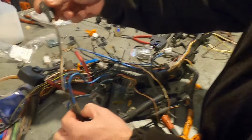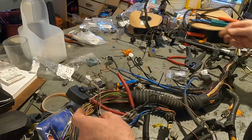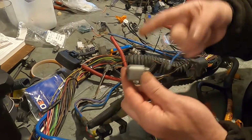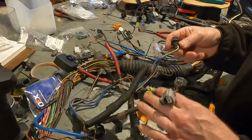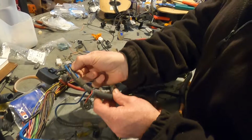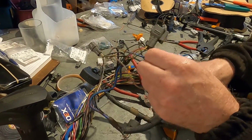Of course, we've also got the cam and the trigger for the coils, and if it's got a hydraulic fan, it's got those as wires as well. And then we've got that mystery sensor on the front that no one knows what it is. That fella is just a noise suppressor. It's not a sensor. That's your capacitor, a little capacitor, to stop your interference. And of course, Toyota are working hard not to have interference in this loom, with the shielded wires. And that's why you've got a brown wire going through there, because it just goes to earth. So there's no earths here.